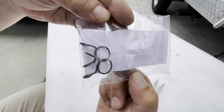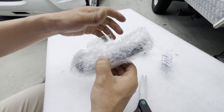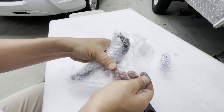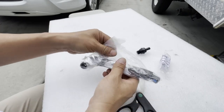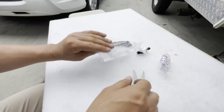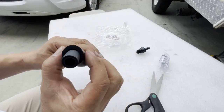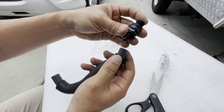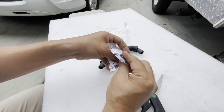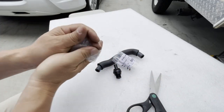These are the hose clamps I bought brand new. You could reuse your old ones, but it's a couple bucks — might as well change everything to brand new. Here's another one. I ended up buying the hose itself too, because since we're taking all this stuff out, you might as well put everything brand new. This is the ventilation hose. It's got a foam protective cover over it, and it goes right in here with your hose clamp clamped on. I bought two clamps, a PCV valve, and a ventilation hose to do this installation.